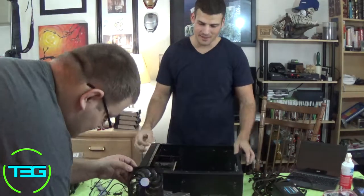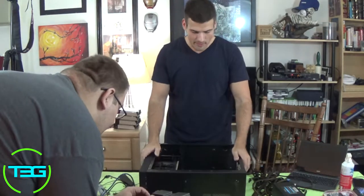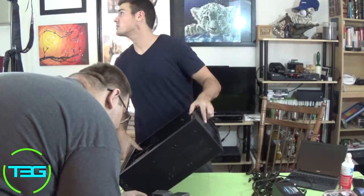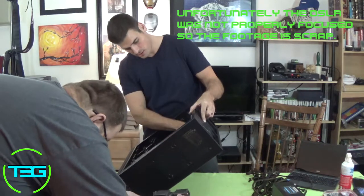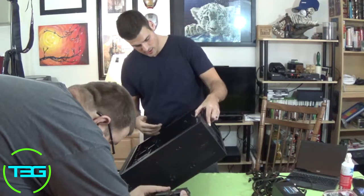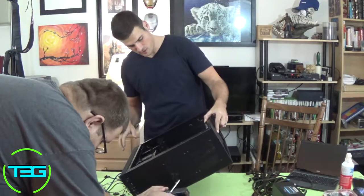As I was saying, while Cerebro is fixing this cooler issue for the CPU cooler, first things first, you're going to want to put in your standoffs for the right motherboard. Each motherboard is going to use different standoffs. Let's see if we can show it to this camera. For us, it's the top three, the middle three, and the bottom three. That's your standard. Then you have your mini ATX. Each one does a little differently. So that's basically what that is.